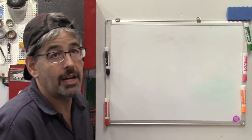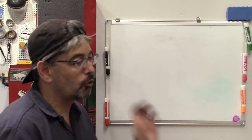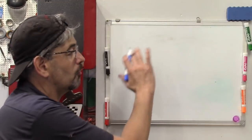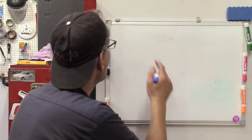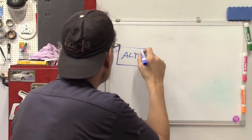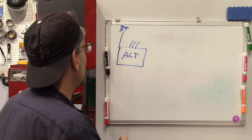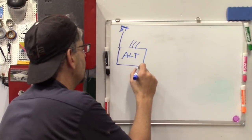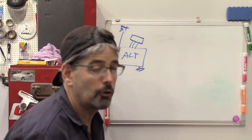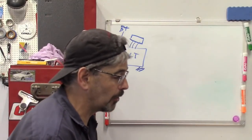We want to understand how the system works with the charging light — what's the deal with how it's connected, and why it would be possible to have the charging light on but not have a problem with the charging system. The alternator and battery apparently are working fine. At the most basic level — I don't know what car this is — just by looking at that warning light on the dashboard, this is just a way to get an understanding of the system in general. The way these systems used to work would be pretty basic: you would have your alternator, a plug into the alternator, a battery positive cable, the alternator may have a ground cable or it may be just grounded because it's bolted to the frame. You've got a connector that most people ignore, but we know how important that is and what the feedbacks are from those wires.